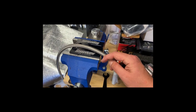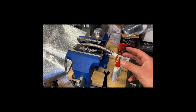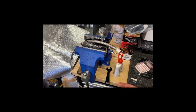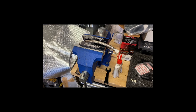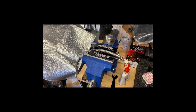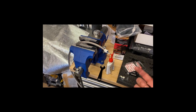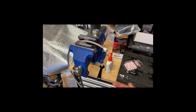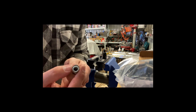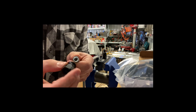This one came from the race works factory with very thick tape on it. It is important to tape the hose when you cut it because it stops the braid fraying, but this stuff's way too thick so we'll need to remove it or we won't be able to fit the hose end on. I've got some aluminium spanners — you can use standard spanners and just wrap the fittings with a bit of electrical tape to protect them. These jaws are designed to hold the fitting in place and make life easier, though you can do it with a bit of angle in your vice. On the car you just use two spanners.